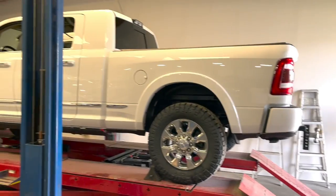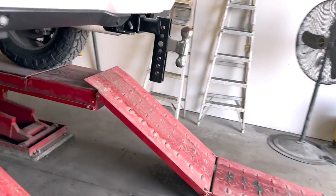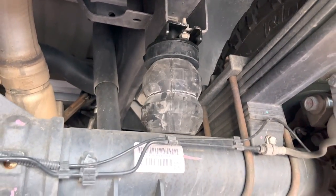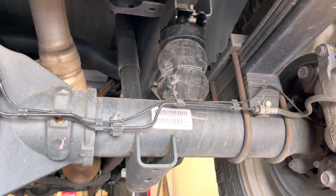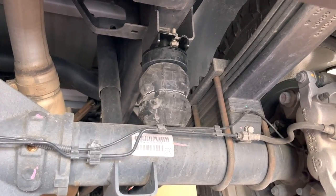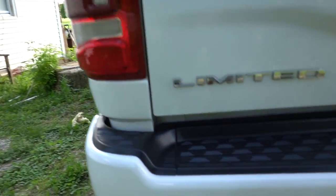She is sitting tall. We're going to take off one of the spacers — yeah, you literally can't even move it. So we're going to take the spacer out because it's not supposed to be touching here. We'll take the spacer off on each side so that when I'm unloaded going down the road it won't be touching the axle. You don't really want them like that all the time — it does make a bouncy ride. I thought I was going to be okay with it, but when we drove it, it was pretty bad. Online it says if you're touching the axle you should just take off the spacer.